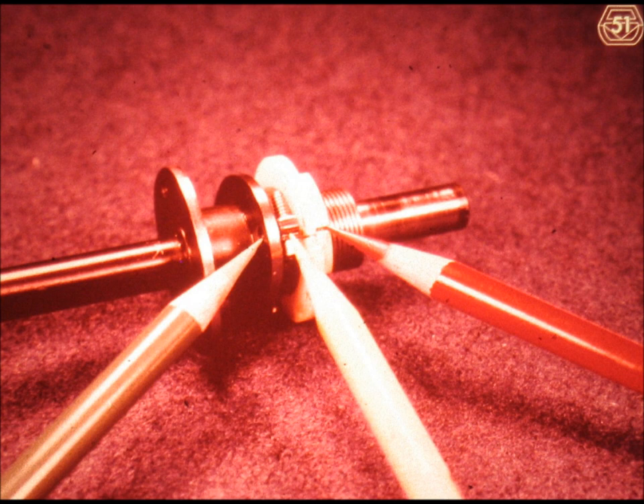After we have preliminarily positioned our cycle clutch spring, we also position—still on a preliminary basis—our cycle clutch restoring cam and our cycle clutch clamp. The slot of the cycle clutch restoring cam (red pencil) should be lined up with the slot on the cycle clutch clamp (yellow pencil), and the clamp should be lined up with the hole for the high lobe of the minus 5 cam. It is immaterial which one of the minus 5 lobes you use; they are the same. At this point, we ask you to make a deliberate effort to rotate the spring only when the whole clutch is assembled and out of the machine. Of course, first you have to loosen the clutch clamp.